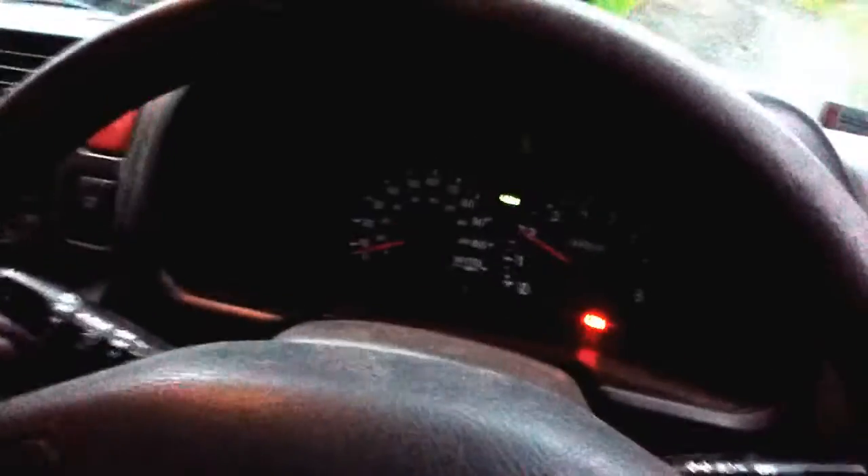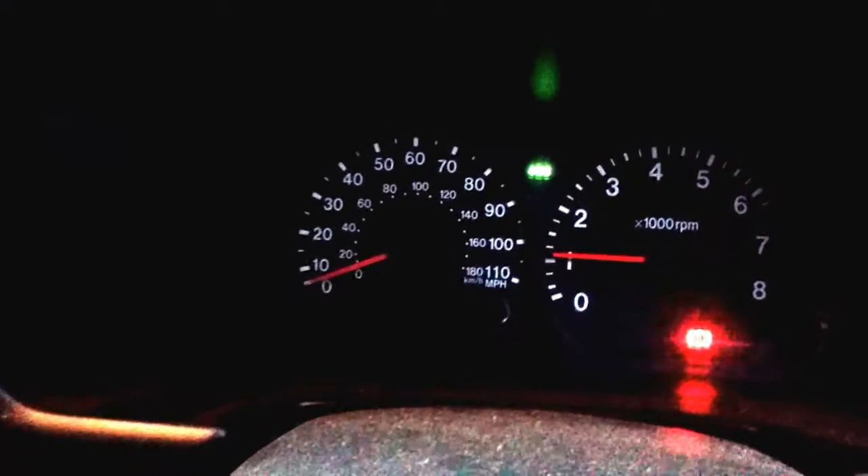We'll start the car. So now it's in four-wheel drive. Flip that forwards — comes out of four-wheel drive, back in four-wheel drive. And now if we press the switch, four-wheel drive goes off. Press the switch on again, four-wheel drive comes on. So it works in high and low, but obviously we already get the option of two-wheel drive high. So its primary use is when you're in low range and you want to switch from four-wheel drive into two-wheel drive.